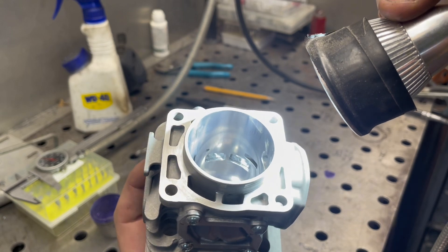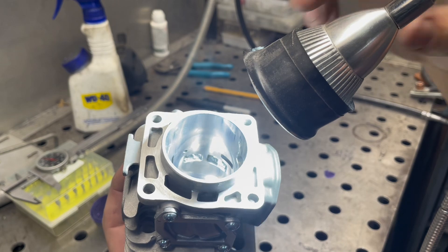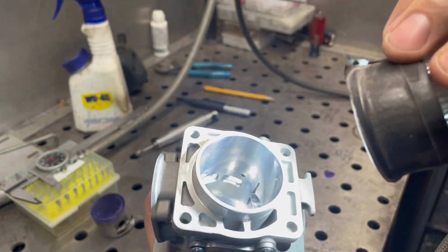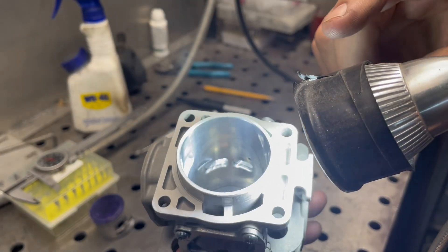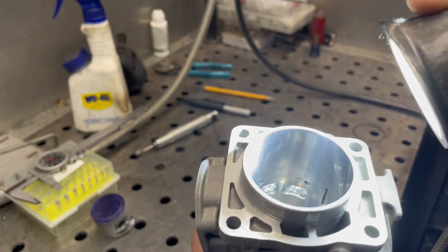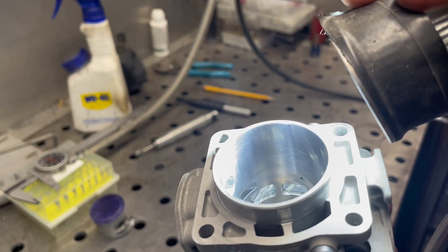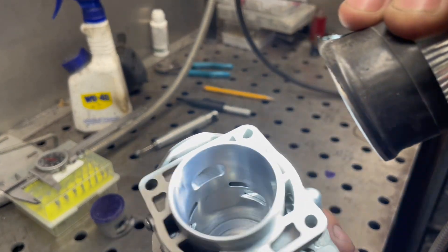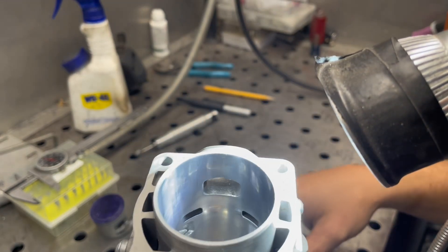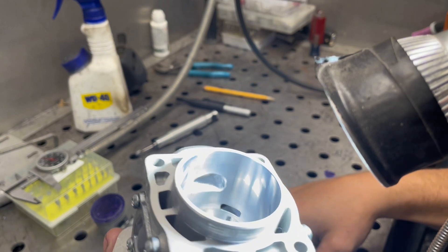So I didn't have to widen the transfers much, just change the direction a little bit on the intake lip — just a tiny bit on the intake side going that way. Other than that, the intake is just kind of a standard intake.